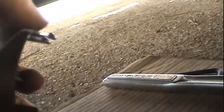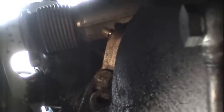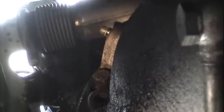You'll have a cover on the top of the bell housing you'll have to take off, a little plastic protective cover that just has these clips on here that you can just sort of squeeze together and lift up. The car is so old it just basically came right off. And let's see, right up top there that I'm shining light on is the CPS, the crankshaft position sensor. You can see the Allen head bolt I've loosened up already. That's a 5mm Allen. So we'll take that out, and then the sensor just basically pulls straight on out.